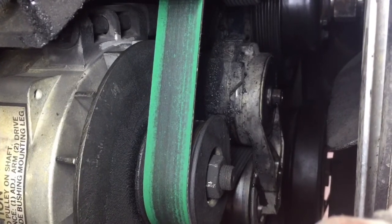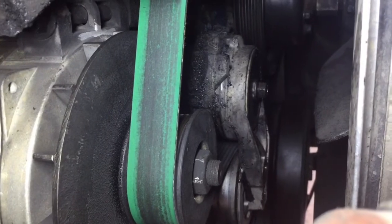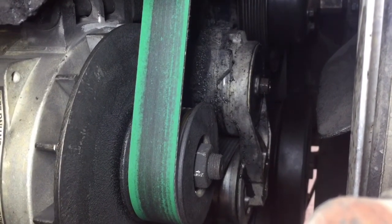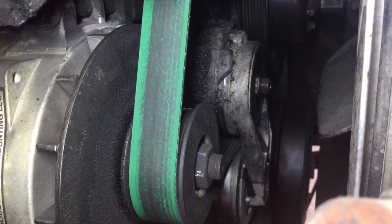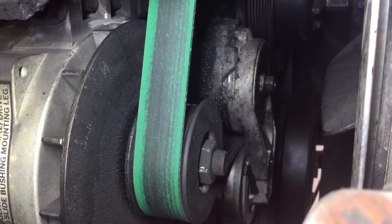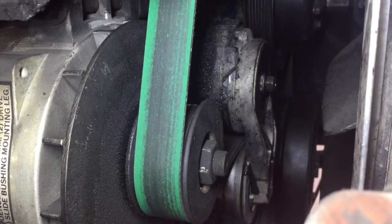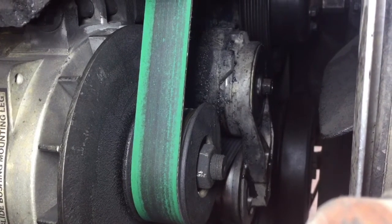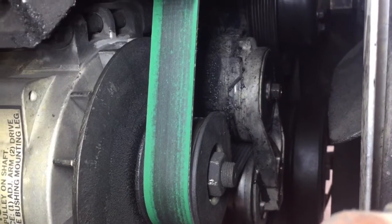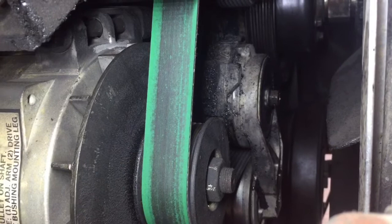In the front case you have a cam sensor — you can't see it from here, it's right behind that tensioner. There's saturated oil around the cam sensor, it's very fresh oil, so I'm assuming that the problem is going to be the cam sensor. But that leak would not cause the oil to puddle under the engine compartment, so that's a problem we're going to address, but that is not the entire problem.